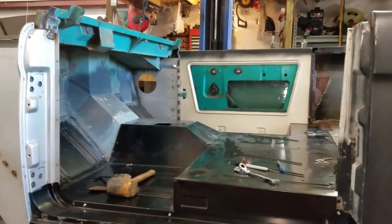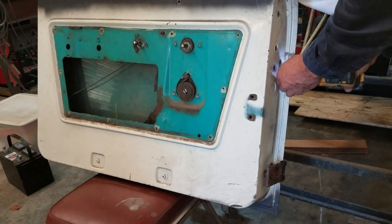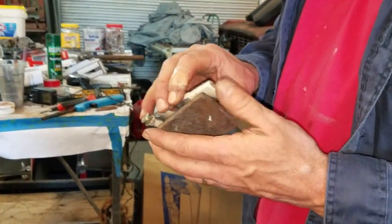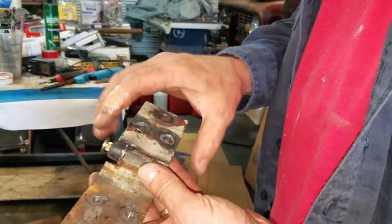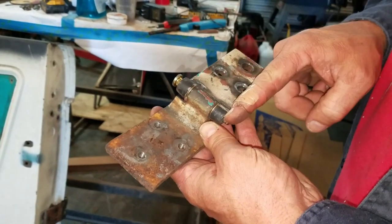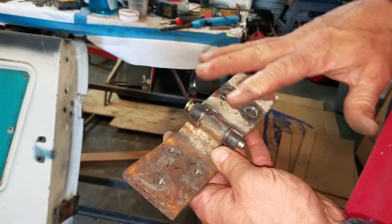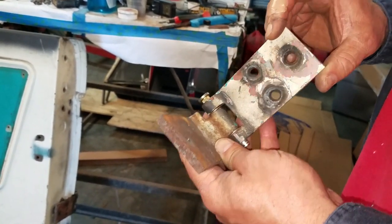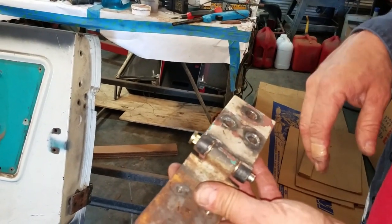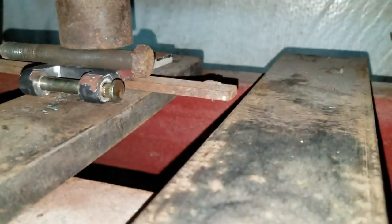This one only needs to be sprung on the top, so we'll go over here to the press and I'll show you how I do that. When you guys look at my hinges — I went and bought some pins and bronze bushings. I haven't countersunk it yet so I can set the pin all the way in and then cut the bottom off. The original hinges were in pretty bad shape; I'll blast these, clean them up. We're just fitting right now, so when you see paint on the doors or anything else, I've got to get it fit, then we'll take it apart and make it pretty. This is just sitting in here so I have a nice tight hinge.